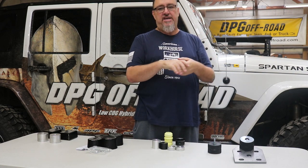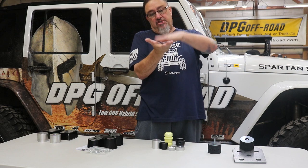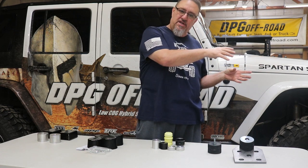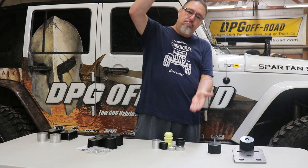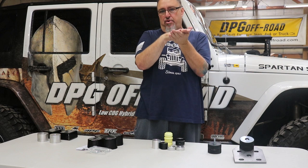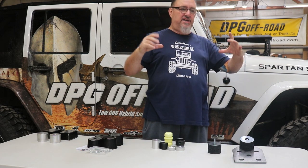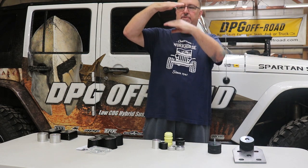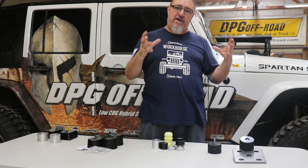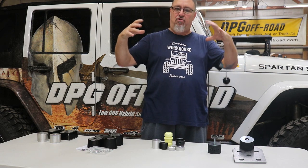On a low center of gravity lift — which we like — it's a smaller lift. With a bigger tire, you'll tend to have less up travel ratio than down travel. If we're bump-stopping for a big tire off the fenders, we can have more shock length to work with, giving more down travel. We want to optimize shock length, tire size, and fender well opening so that full compression happens at roughly the same point — shock bottomed, tire just short of fender, and bump stop jammed.